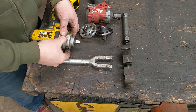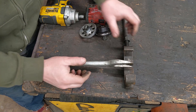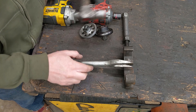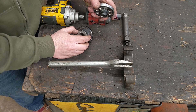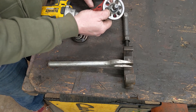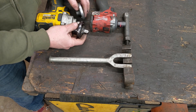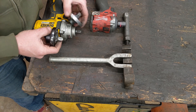There is a balance though — this larger impact gun has bigger hammers than the smaller one. If I made the rod a hundred pounds, whacking it with a small hammer isn't going to do much work because now I'm trying to move that mass. The lighter weighted adapter, about 300 grams, seems to work way better on the smaller impact gun. The heavier one, about 600 grams, actually works worse on the smaller gun. The bigger impact gun likes both, but actually makes more torque with the lighter one.